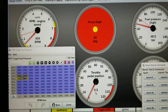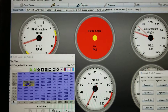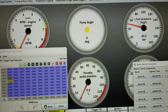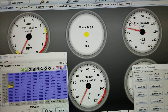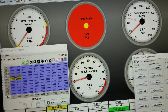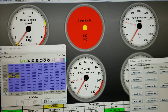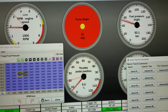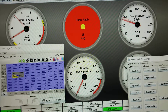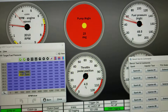Sometimes it's kicking back and it's not always starting. Sometimes it does and then it dies — that's very untuned. There's no coolant temperature sensor because I need to solder it. There's no intake air sensor because I need to solder something. Now it started with throttle pedal application. I let it go and it still runs, wants to die. Idle control is not set — nothing is really set here.